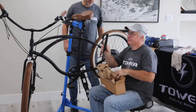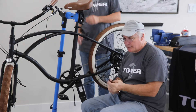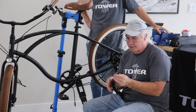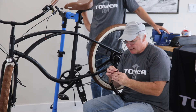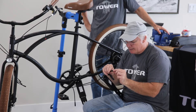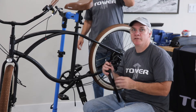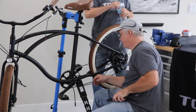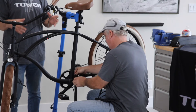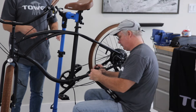So this is how the controller will mail to you. It's a very simple piece — swap out the other one, put this one in. It's got three plugs on it: one is the pedal assist sensor, one goes to the motor, and one goes to the wiring harness. They are all specific and they have arrows on them. They have centering pins, and you just want to take note as you plug each plug together to make sure that you have your orientation correct. One of the biggest problems with electrical systems is that the connections aren't correct — there's an error code 30 that basically means the connections are kind of bad and it's just not communicating.